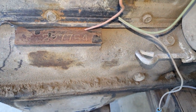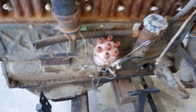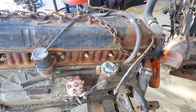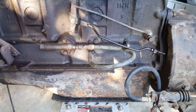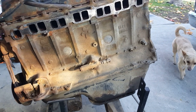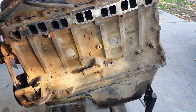Because a '73 or later F would be an F-point-five, or F-and-a-half — and yes, there was an F-and-a-half. The only difference was down here it had an oiling port similar to the 2F, and it wouldn't have had the oil pressure regulator here like this one does. That's where the oil pressure comes off, goes up through the filter and back. They called it the updated F, or F-point-five, before it evolved into the 3F.